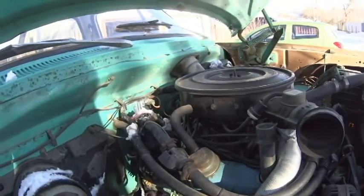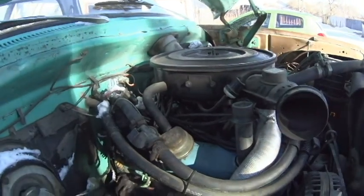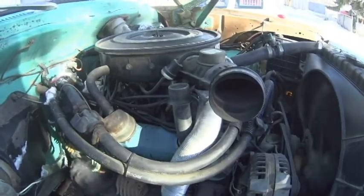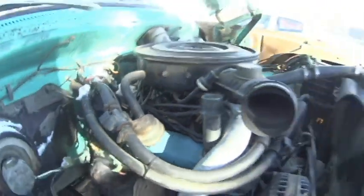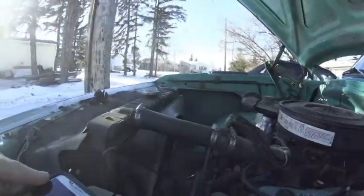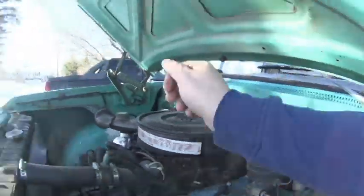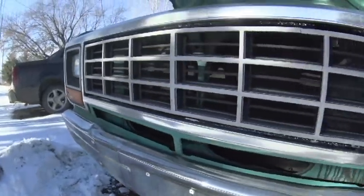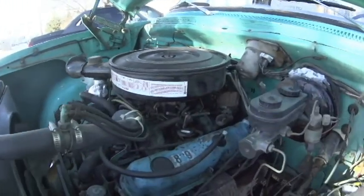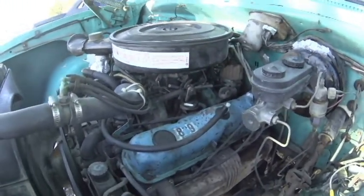We're running a little low on idle. We'll see if it comes up a little bit. That's what it's like when she's cold starting — a little rough. There's no high idle there, and I'm not sure why that is. It could be that the choke is not properly adjusted. Why the high idle isn't kicking on is what I'd like to know.